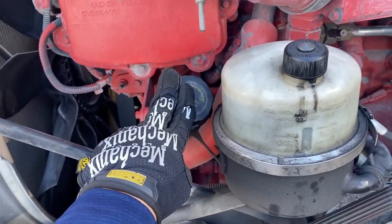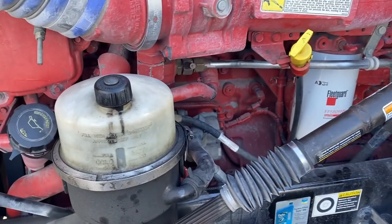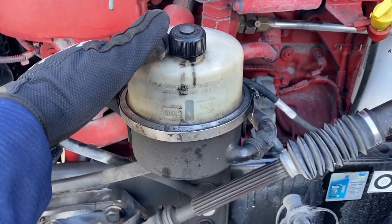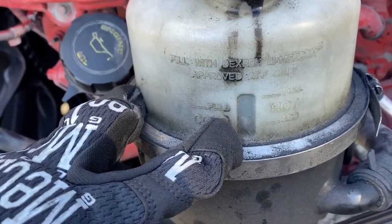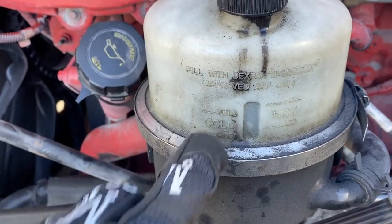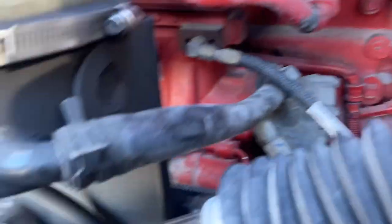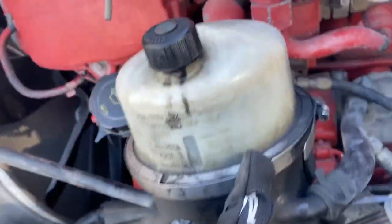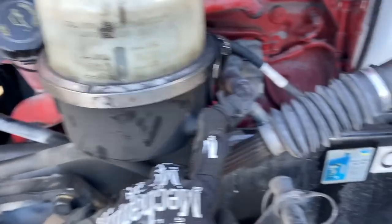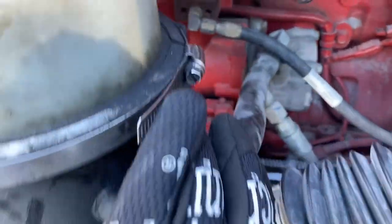I like to move in systems and in a direction so I don't miss anything. I move on to the next closest thing which is the power steering fluid reservoir — it's got a cap that's secure, not broken, the level is properly between add and full. Make sure it's properly mounted, the bolts are secure, not loose, not cracked or broken, mounts are properly clamped and secured. Then move on to the actual hoses of the power steering reservoir to make sure they're not ripped, frayed, no bubbling, properly clamped, and no visible leaks.